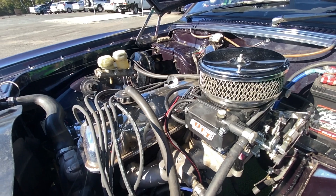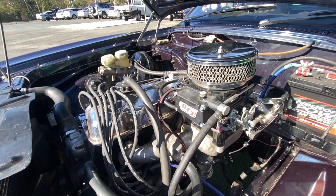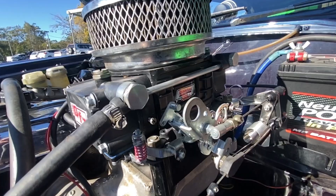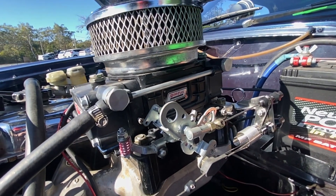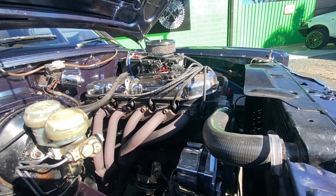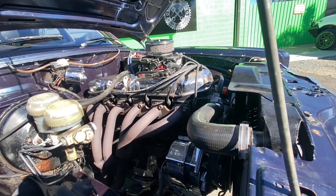It's got a blue plate with multiple compliance codes on it, so it's completely legal - everything's good to go. The engine wasn't running at all when we first got it - running really badly. It had a 780 Holley on it, which is far too big for this engine. As part of the deal, a smaller Quick Fuel four-barrel came with the car, so we put that on as a temporary measure - though that's still a bit too large. The car starts to run now though.